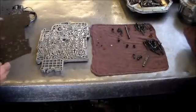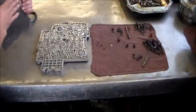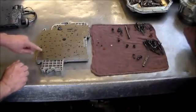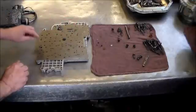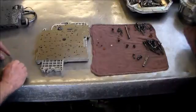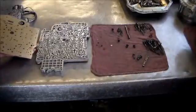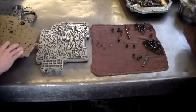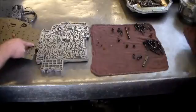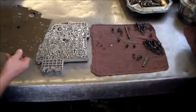What I normally do is say the valve body is still together and the plate is still on. There's a gasket that only goes on one side. You can see sometimes the orifices stick to the plate — you can see the colors sticking up — so I try to poke everything down so it'll sit in the valve body and not get stuck to the plate. When I take the last bolt out, I take the plate and just flip it up, holding it in place, and see if anything got stuck accidentally. If there was an orifice there, I'll know exactly where it goes based on how the plate sits.